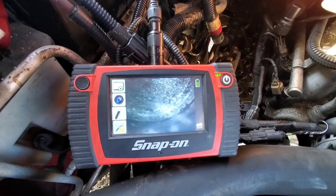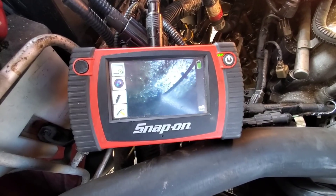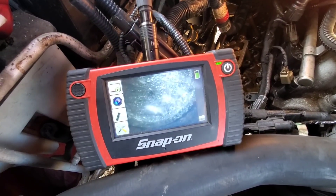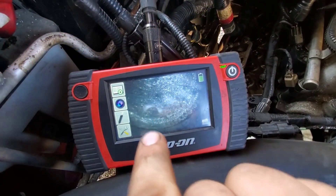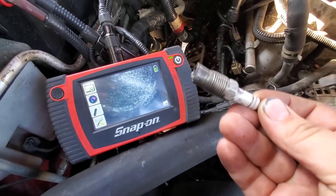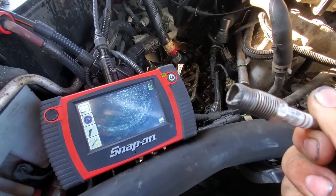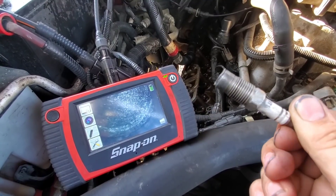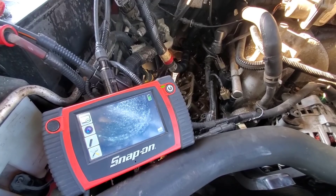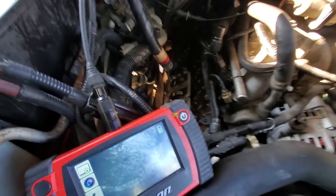If you guys can see — there's a side camera option on that — you might be able to see better. Either way, the top of that piston is not looking great. I can see right down here — the outer edge of the piston is damaged. The rest of this spark plug is nowhere to be found. The cylinder has literally beat the end of this spark plug off. Yeah, it's not even the right spark plug for the motor — it's way too long a plug. This thing has just destroyed itself, and that's probably why it kept launching spark plugs out.